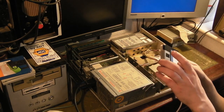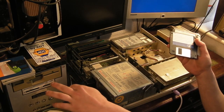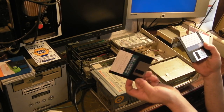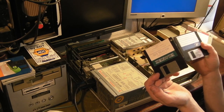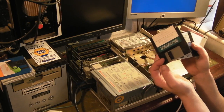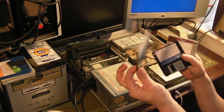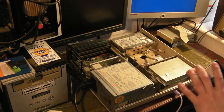So I don't think that's probably going to be the issue. Even if the drive is set as a 1.2 meg drive, providing the disk is a 720K disk rather than a 1.44 meg disk, it should actually still boot — the drive parameters are set wrong but I remember that from the past and I'm sure that works. Even though it's a 1.44 meg drive being set as a 1.2 meg drive, it obviously won't boot a 1.44 meg disk, but a double density 3.5 inch disk I'm pretty certain will still boot. We might as well try that using the Bridge PC just to make sure my memory hasn't left me.